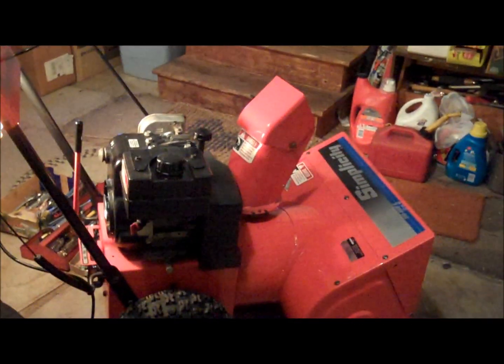Hi, my name's Tom. I'm making this video to show everybody how I diagnosed what I think is a compression problem with our snowblower. The symptoms are that it runs fine at idling — it sounds like it's running fine — but then as soon as it gets into snow, it bogs down and starts to stall out. So it has no power, or very little power, under load. I went through all the carburetor adjustments and even rebuilt the carburetor, because everything I read on the internet said that was probably the problem, but in fact I think it's a compression problem. So I'm going to show you how I diagnosed it.